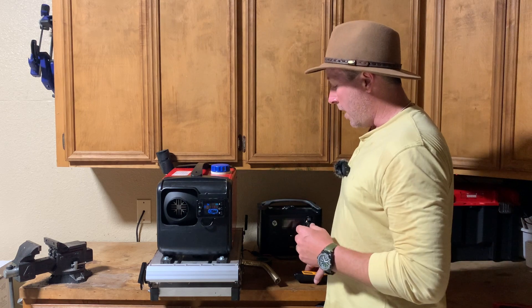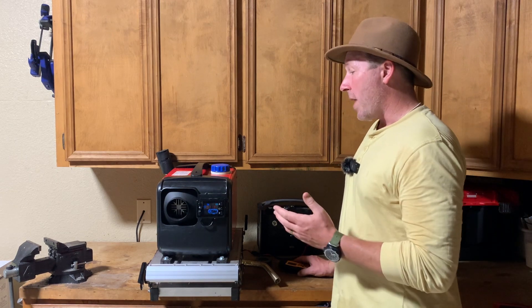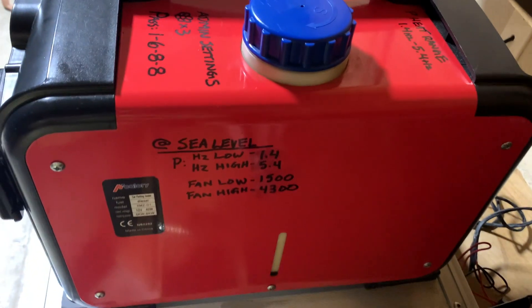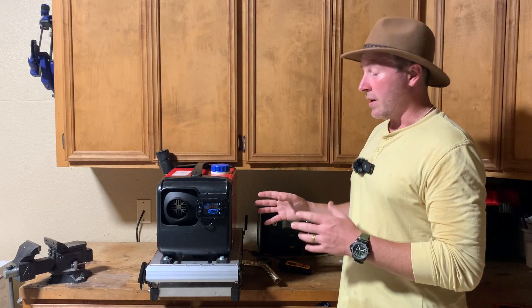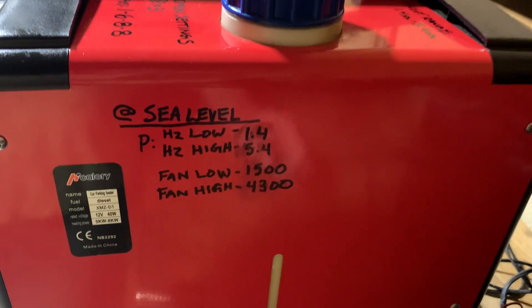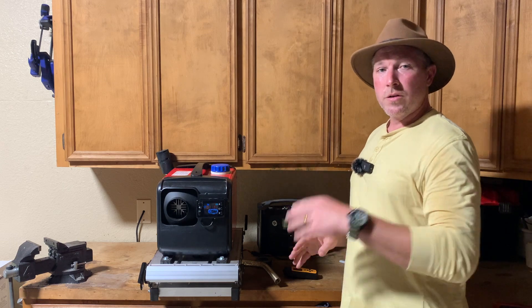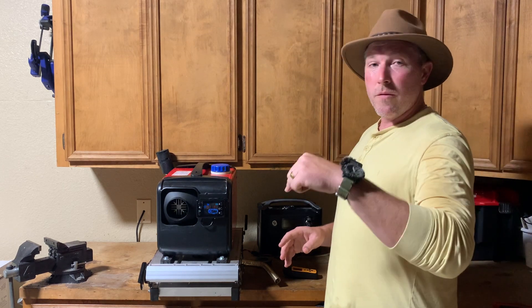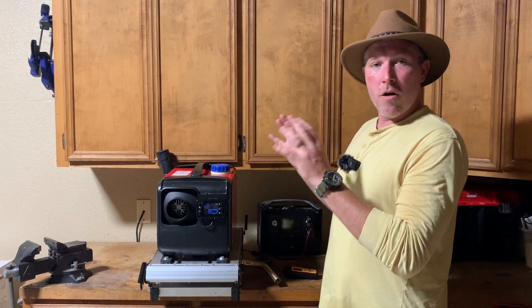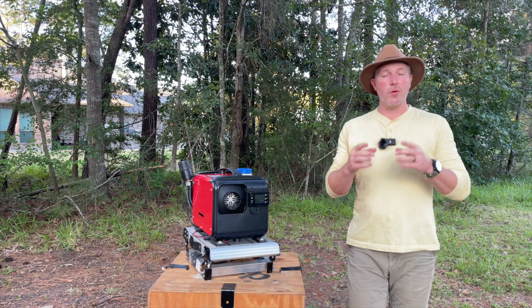That's the whole point of actually doing this. You can double check it with your air analyzer, and if everything works out, you're all good. For my settings, I'm at sea level — I went ahead and wrote it on the side of the unit so I know if I get back to sea level I can quickly put it back or at least double check it. Anytime you go to a different elevation or geographic location, you can always double check your unit. And if you do all these settings and figure out yours, go ahead and put a comment below with your elevation or location — it can help me and others get a general parameter of what needs to be increased or decreased. If you've made it this far, you now have a diesel heater that is tuned specific to your location.